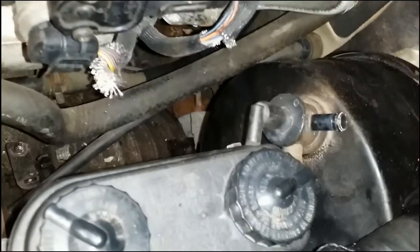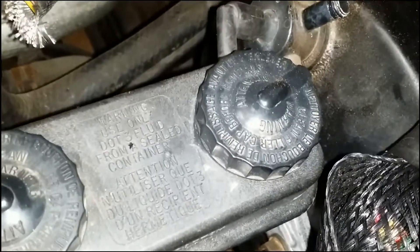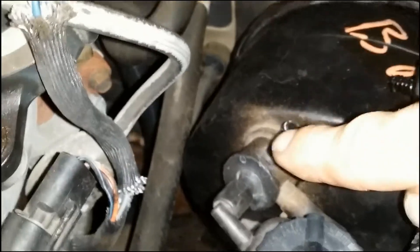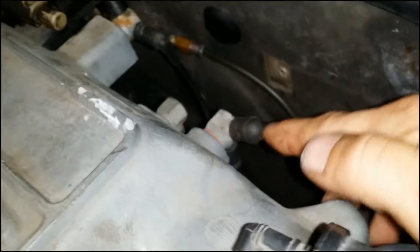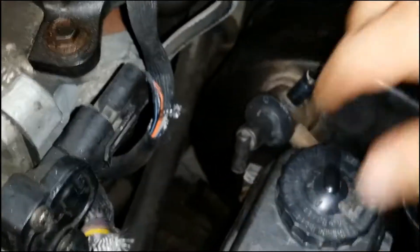I have everything plumbed up completely and the booster is attached from the back. The next thing to be sorted is the vacuum lines, which I think I have figured out. I think there's a port right there that I'm going to use, and the climate control comes off of either here or there and gets moved over here. I need to go buy some fuel injector hose to go from this port back to that port — just take that plug out. That's my plan.